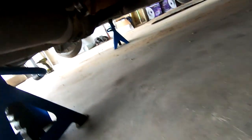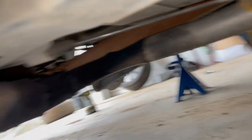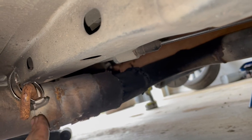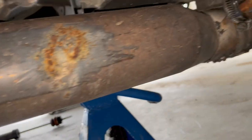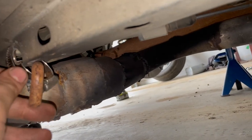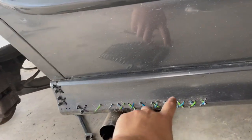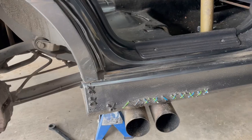While we're here let's have a look at the exhaust. These blasties were given to me from my mates, so they're a bit rough - got crappy welds everywhere. But I've literally just welded them onto the back of that joiner at 45s. Before, it would come out to about here with just an oval past here. I actually cut it further back so I could have the blasties come out just enough that they protruded, but they're also pointing to the back of the car. You can see it joins up with our system, keeps going to the cat up the front. Still got a cat but it's still really loud. We've got a hanger and then a hose clamp through the rail to hold it - the blast pipes are sitting up but still have some movement. They sound really good.